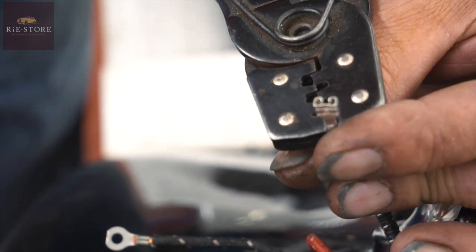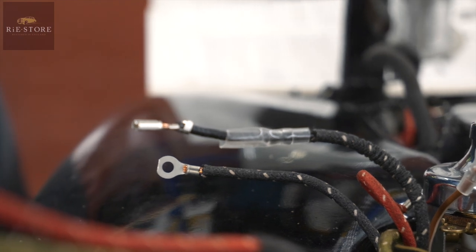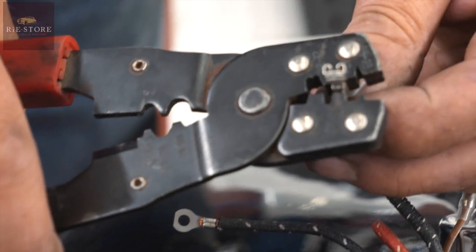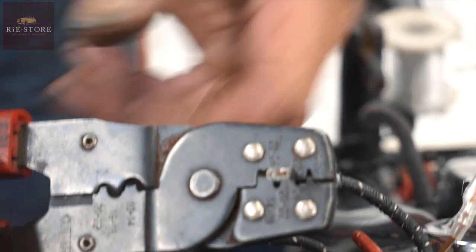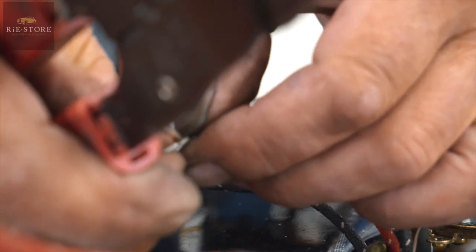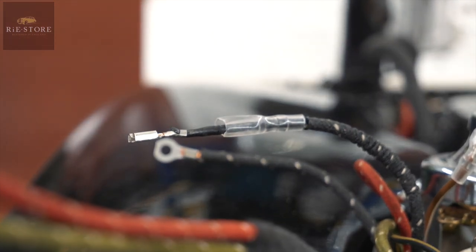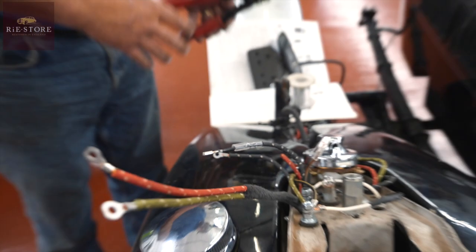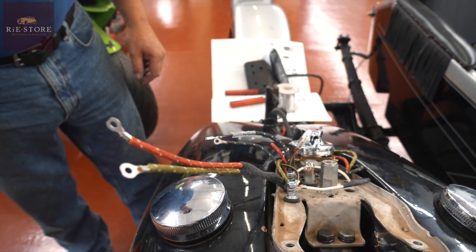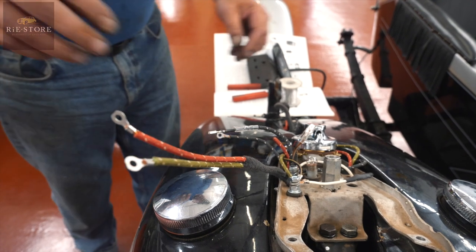And all these parts, just generic parts? Yeah, this is just a wiring kit. You buy a box of the ends and the right pliers. So one type of connector is no better or worse than the next? These are pretty good. What ones are these? They're more of a Japanese set, to be honest with you, than an English one. Your English stuff is bullets, what they call Lucar connectors. Your Yankee stuff did do some stuff like that, but not much. It's just all different types of connectors.